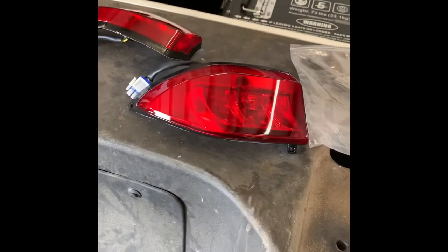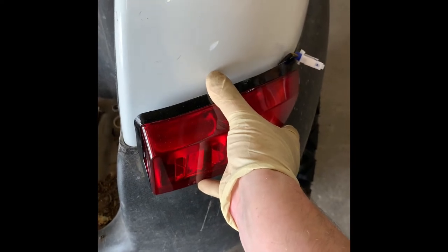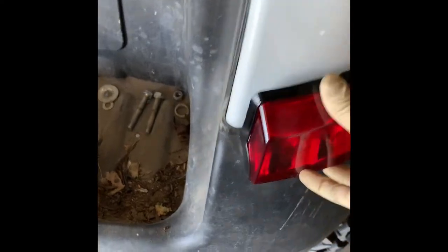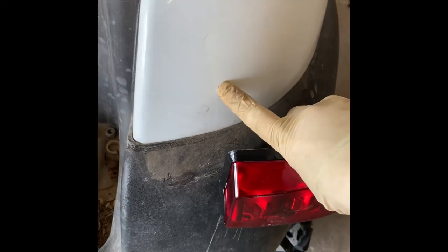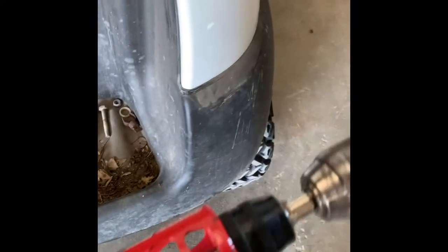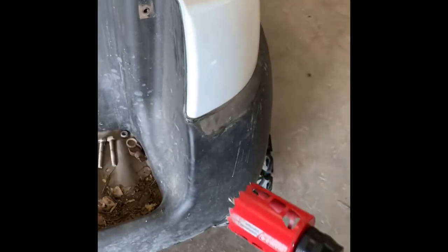Out of the box, I pulled the tail lights out. The easiest way to do these is just to put them where you want them — if you want them a little further out or flush, set it right there and mark your hole. You can see you have to fit that wire through the body, so get down there, see where your wire is at, put your finger there, and you know where to drill. Then just go ahead and drill your hole. I personally use a two-inch hole saw for this and I just drill right through it. Let me go ahead and drill both holes.